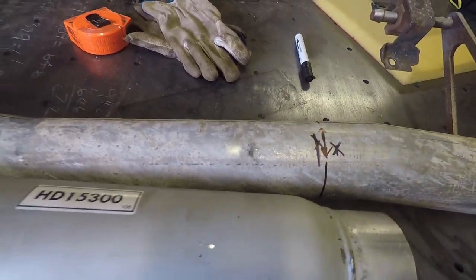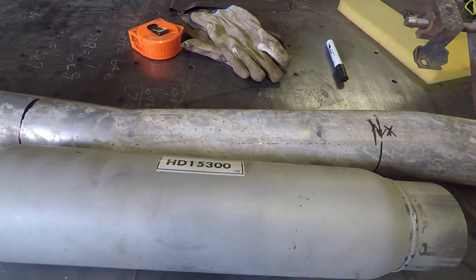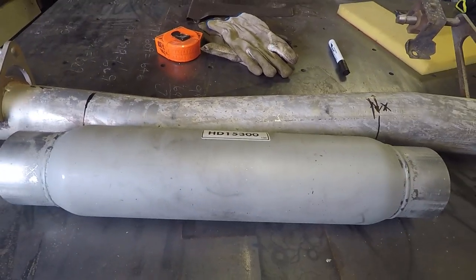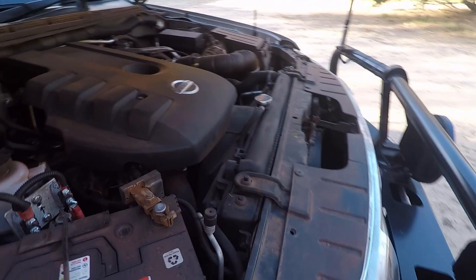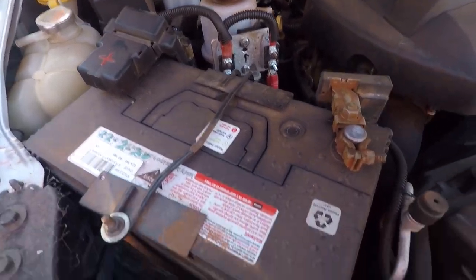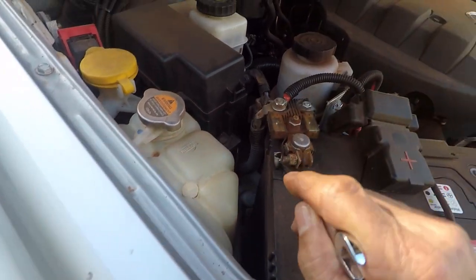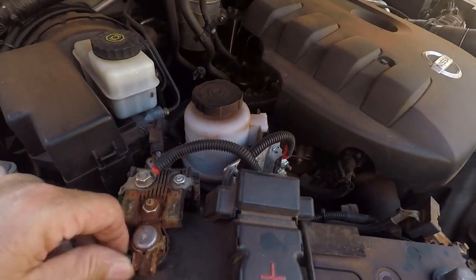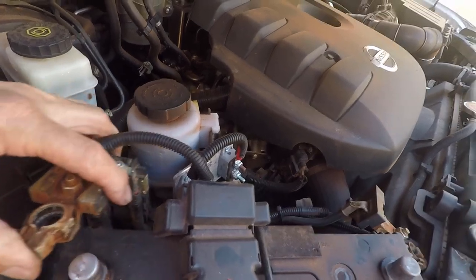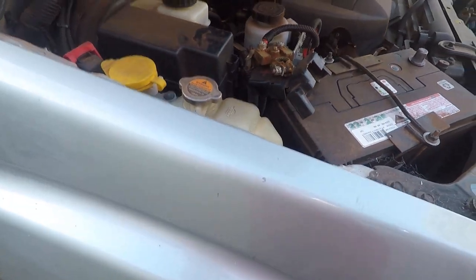That'll give me a 50mm tail that'll go inside, and then I can put it back in the car, line all the flanges up, bolt it all on, and tack weld the muffler into the pipe while it's under there. Before we do that it's important to disconnect the battery — you don't want to be welding on the car while it's connected because that could spark the electrics. I'm going to do that now: just going to disconnect the battery completely and put that out of the way.